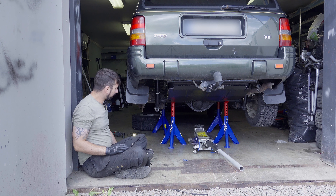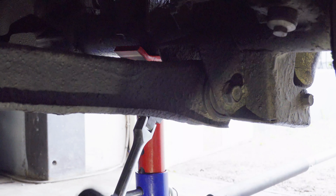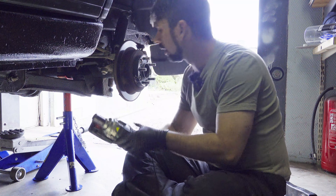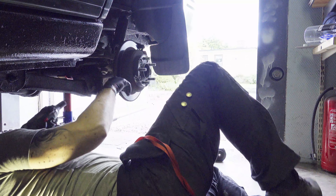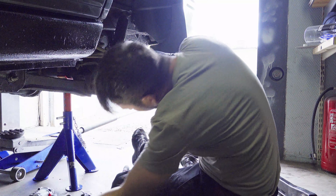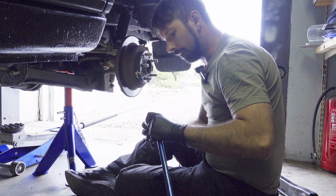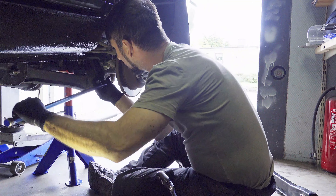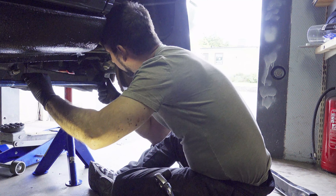It's also a good idea to remove the tires because that makes it easier. So let's dig into it. There are two bolts holding down the control arm — one in the front and one in the back. It might be tricky to put the wrench in here, so I'm going to see if I can come from underneath. I'm not going to be able to do this, so I need to break it loose manually. That should be just as easy, probably even better.